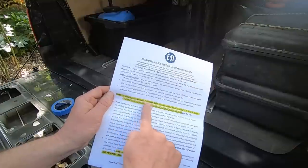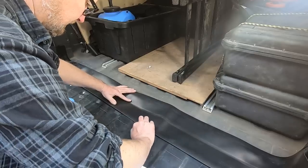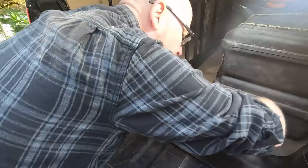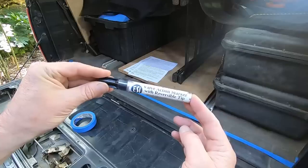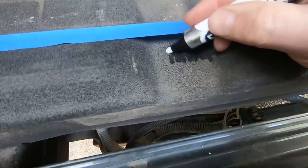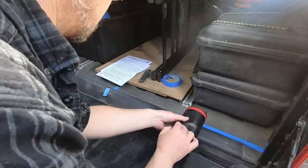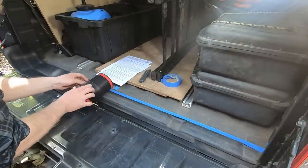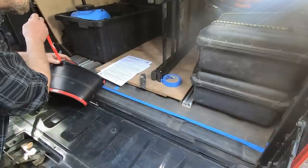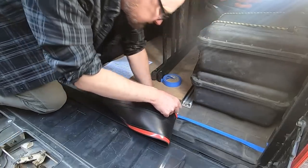There are special instructions for if the bed of your truck is contoured along the bottom like mine is. The instructions suggest using painters tape to create a temporary reference marking, then use the supplied adhesion promoter along where the adhesive strips will be applied. Trucks with smooth beds can start at one side and work across, but for contoured beds they suggest starting in the middle and working outwards. I had to cut through the backing in the middle in order to start peeling it off. The instructions say to pull off about a foot of backing and then start working your way towards the bed rail, working the material into the contours of the truck with firm pressure.